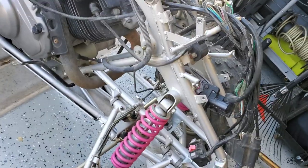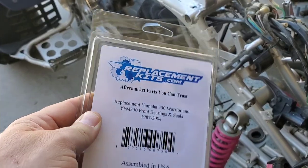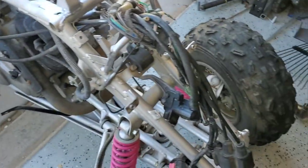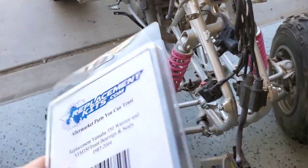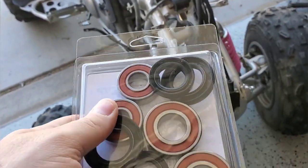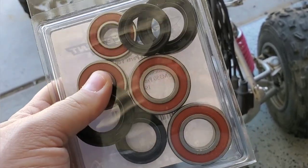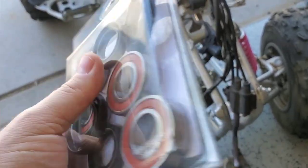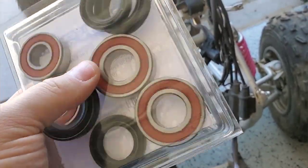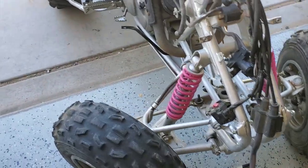We ordered from replacementkits.com — we got a set of front wheel bearings and seals, so we're going to be doing wheel bearings on both front hubs. I went with these guys specifically because their bearings are supposed to be NTN — basically a private label NTN, which it looks like from the orange bearing races. Quality bearings are extremely important; I don't want to buy random junk.